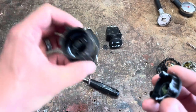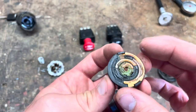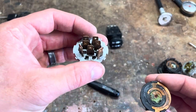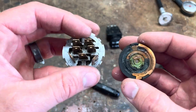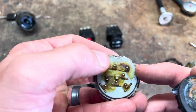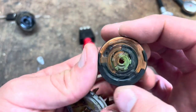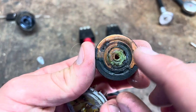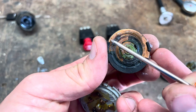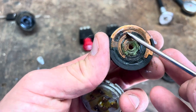What's less intuitive is what's on the back. These three female pieces fit into those male pieces, and so this disc turns. On the back of the ignition switch you have all these wires — seven in this case. And on the underside you have what I would call little buttons or contacts — they're kind of rounded-over pieces of copper that connect to each of these. And as you slide this wheel or cam, it connects different things.